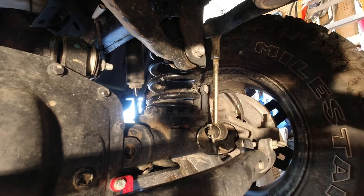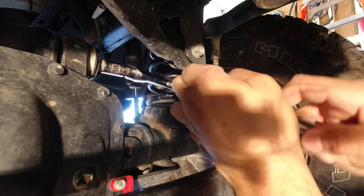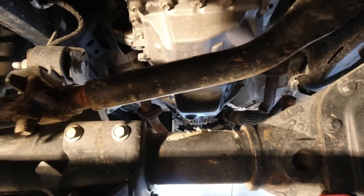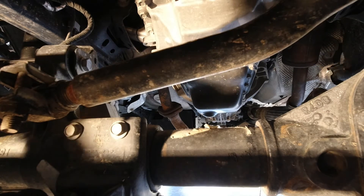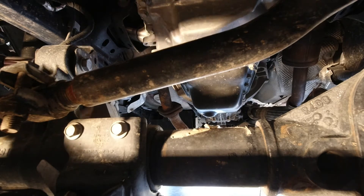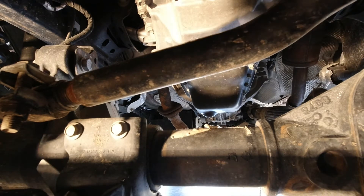Control arms are 18 millimeter. Check those — they're tight — and we can check the other side as well. The breaker bar is nice to tighten things up, but it can be a little bit of a pain because you can't ratchet it. That's tight.